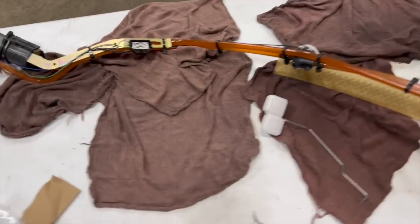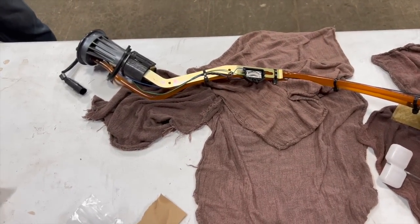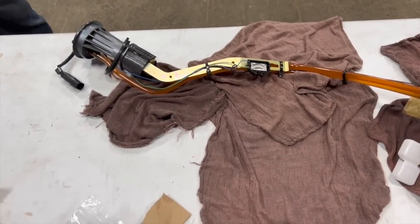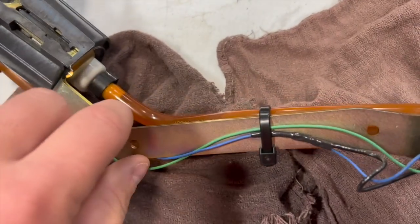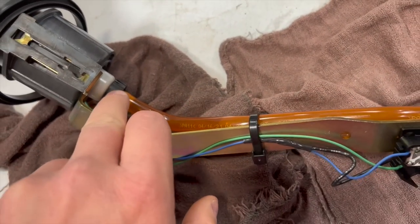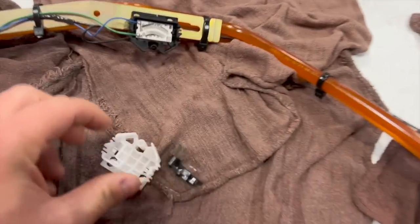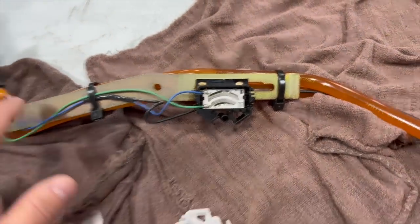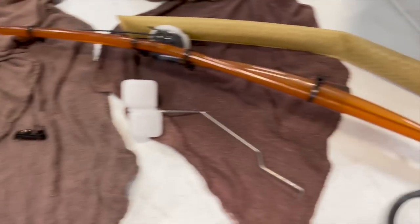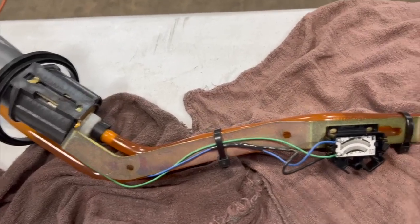This is the inside of the fuel sending unit from inside a tank for your trail sleds — this is like XCR, XCs, VR1s. This one looks a little bit different than the RMK. With this one, the dealership is replacing the clamp from a metal one to a plastic one, and this black piece — which was a white one — and this arm. So all of that is getting replaced in here. There are legitimately different kits; it's not just a myth that people are saying that.